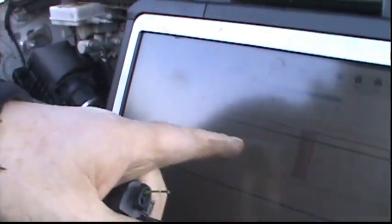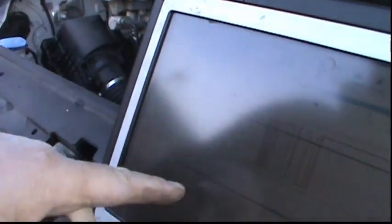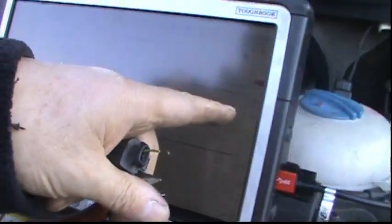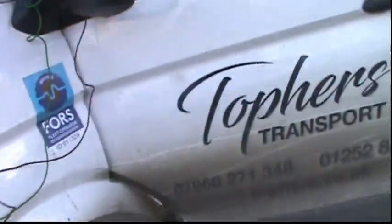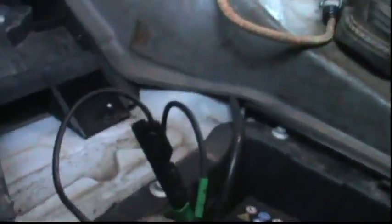So I've had a quick look. I've got my signal from the battery and, as you can see, we're only reading 8 volts on one channel - the other one's 12, which I think is the battery and alternator. But it was reading 12.57, so the battery's fine. I'm checking the LIN bus, which is fine, and then I'm checking my earth wire and my positive wire, so that's given me my voltages.